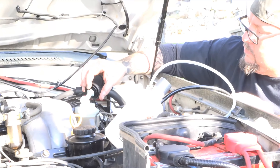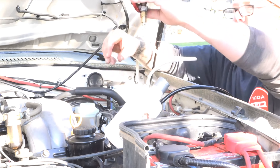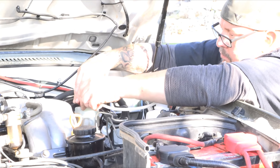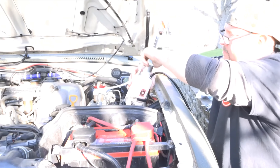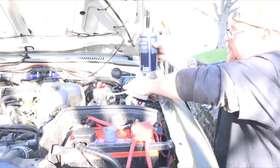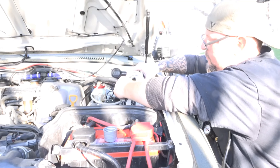First thing is throw on a pair of gloves. Brake fluid is highly corrosive, and try not to spill it under the hood. Pull your master cylinder cap off. Take the Speedy Bleed aluminum cap with the O-ring and gently press it in — it'll pop right in. Set the three wing nuts and make sure it's secure. Now take the reservoir, remove the cap, make sure you don't have it pressurized to your tire yet, and fill it to the line at the top with brake fluid, whatever brake fluid your vehicle needs.